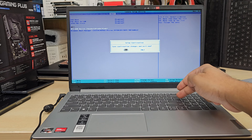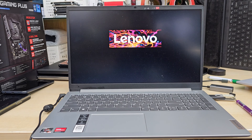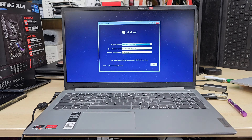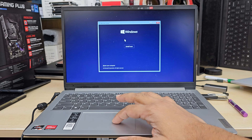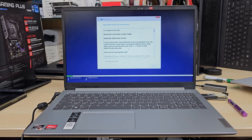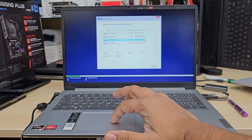Hit Enter and leave it. Now it should go back to the Windows setup page, and then we'll reinstall the system and everything will be fine. So this is loading up — we're going to hit Next. This is quite simple, just don't make any mistake because it's quite straightforward. Accept the terms and conditions, select the internal drive where to install Windows.